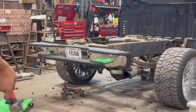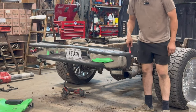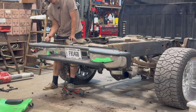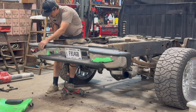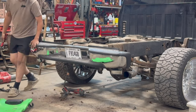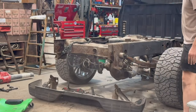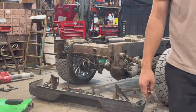All right, so we're going to get this bumper off here, get all the bolts out. Just got to knock out these little tabs here that hold the bolts in, and it should fall right off. There's one side knocked out fully, and there's the other side.